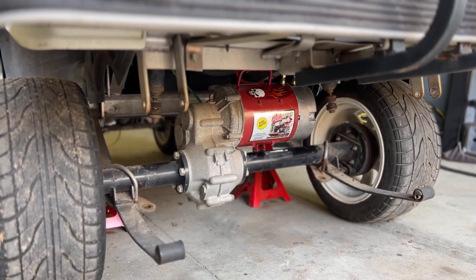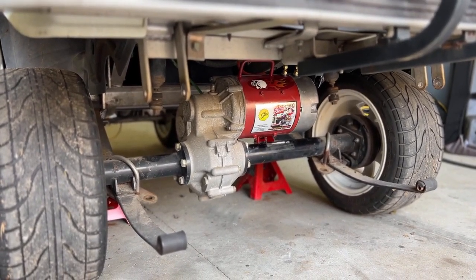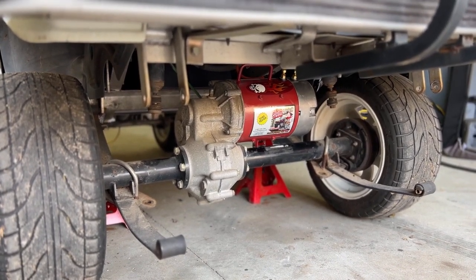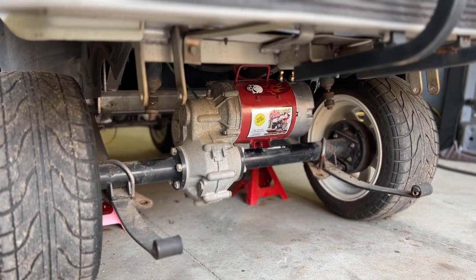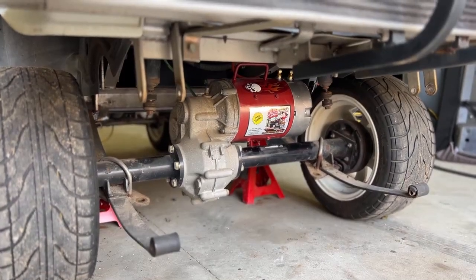Now we need to replace the cables on top of the motor. Remember, it's best to use the two-wrench method — one wrench on the lower nut of the stud while tightening the top nut — so the stud does not start to turn and you damage the motor before you can even use it. I'm going to go ahead and button this up and we'll meet out on the road.